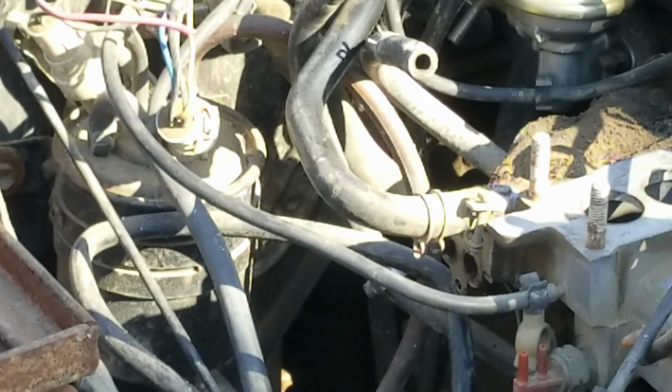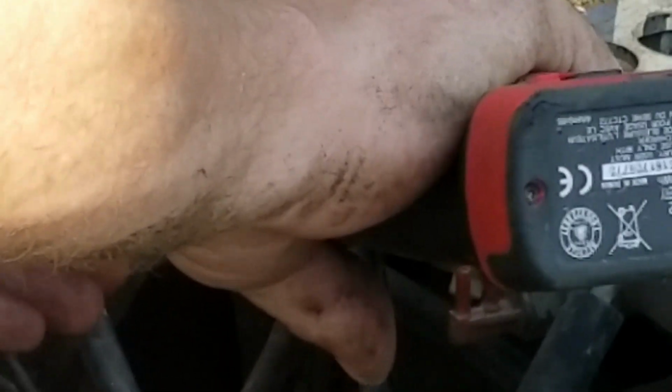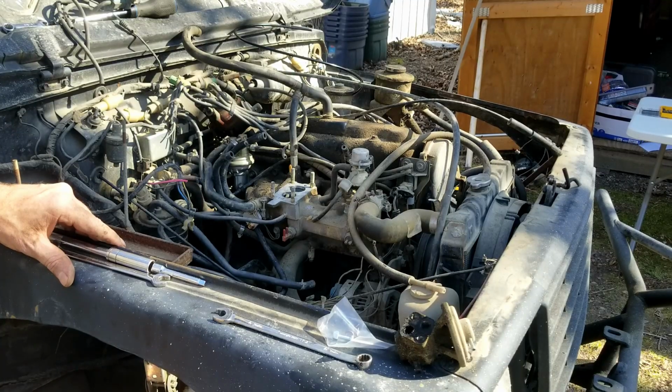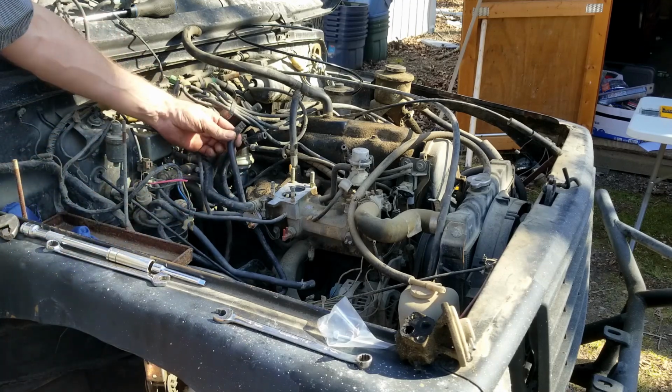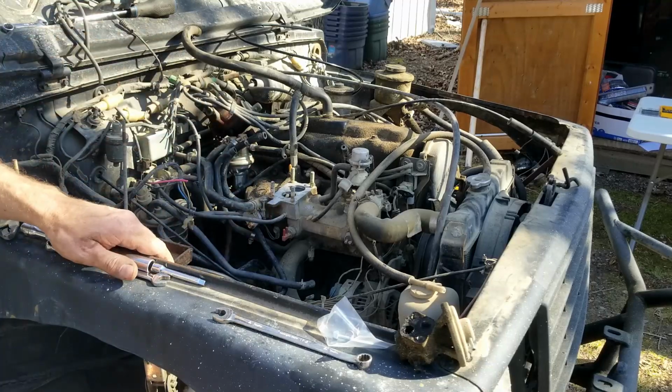Use the supplied block-off plate gasketed hardware to cover these ports. All right, what we're going to do now is use four 1/8 rubber caps and one 1/4 rubber cap to plug the following locations. If you need more than these caps that are provided in the kit, you could always buy these rubber caps at the auto store. They're common. One of the stock carb choke water hoses, the longest one from below the manifold, will be looped back to the manifold next to the heater hose. Beware that all of these vacuum and coolant ports and plugs will need to be watched over for the next couple of heat cycles to check for leaks.